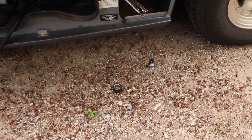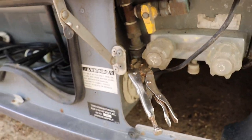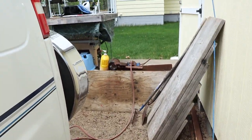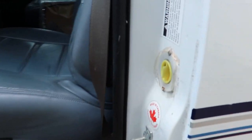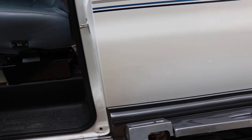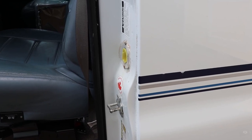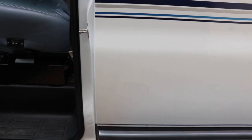One thing is it's kind of hard to get to the water fill — it's just on the end of these vise grips — so you wouldn't want to have to connect that too often. Just pick up a Gardena filler. Then I have a hose here. This is not meant for potable water, but you're never going to find a hundred-foot garden hose that is meant for potable water, so you need that for filling it up. You're going to need bleach. They want you to put in a quarter of a cup per 60 litres of capacity. On my van the front tank is about 90 litres. You need to check your manual because getting the correct amount of chlorine in there is one of the key parts of the whole thing.